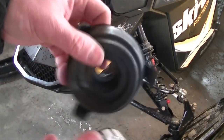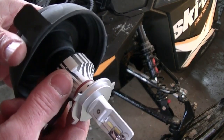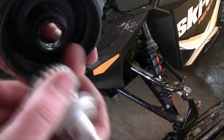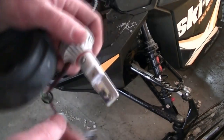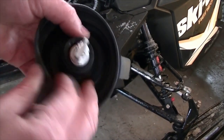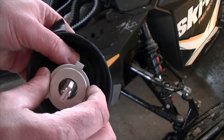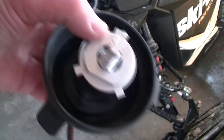I made a mistake in the first video I ever did putting in those Moto LEDs — I mean they worked, they were fine, but I buried them underneath the rubber grommet. I even cut it to make it work, which was wrong. I actually melted this grommet, so it destroyed it. The way to do these properly — and one of the viewers pointed it out, so thank you very much, and I confirmed this with LED Eagle — is put it in like that, install the bulb, then clip it so you install this into the housing, and then you can slide this all together and it'll be nice and sealed up just like it should be.